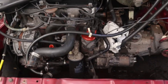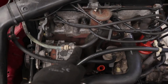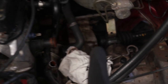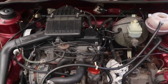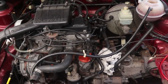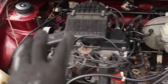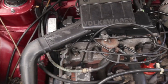The radiator is out. As you can see it gives you much more space to work with. All I've got to do now is take a couple of these lines off. I'm going to take the starter off as well, then loosen the drive shaft. Once that's done, I'll jack the car up and put a crossbar here to keep the engine, then start loosening all the mountings. I also need to take the gear shaft linkages loose, and I'm going to take off the air filter box to free up some more space before taking the lines off.